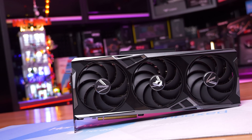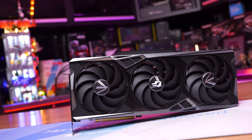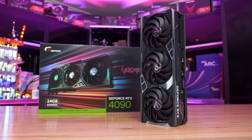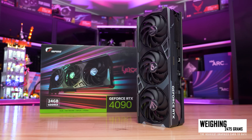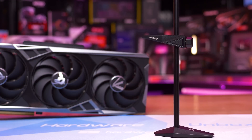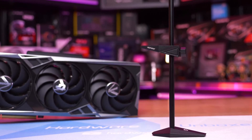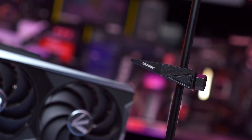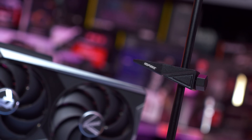The Vulkan OC is a really impressive looking RTX 4090 with neat features such as the detachable iGame smart LCD and lightboard. Weight-wise, this thing is a juggernaut — it's 6% heavier than the massive ASUS TUF Gaming at 2475 grams, making it the heaviest graphics card I've ever come across. Colorful has included a support arm, though it's a janky solution compared to the bracket Gigabyte uses — more of a standalone pole, but certainly better than nothing with almost two and a half kilograms of graphics card.